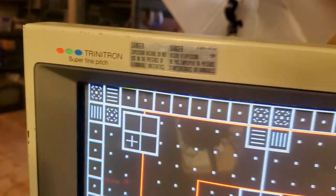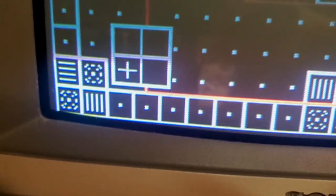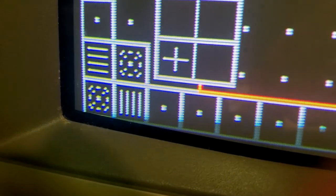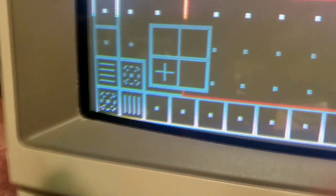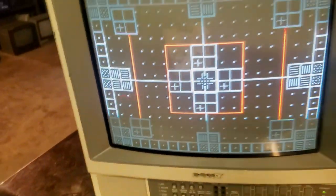There's a convergence strip that should probably be added in that corner — that's pretty typical. The opposite corner looks really clean with no color separation. Along the bottom it also looks clean, but the other bottom corner has some blue drooping as well, so that's another one to try to adjust, though it'll be a more difficult corner to get into.